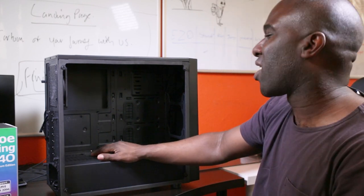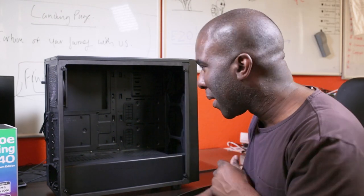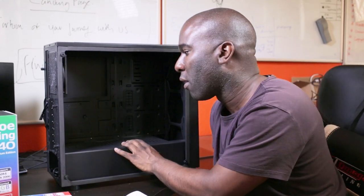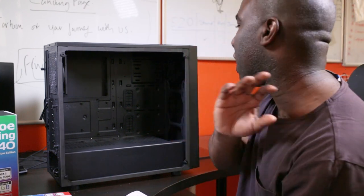Right, now we've got inside the case. Now, this case looks absolutely stunning. This case is bigger than the other Thermaltake that I did review. Links in the description down below about that one. But this one is pretty cool because it's got a nice little shroud on it, which most cases do have, obviously. 7 expansion slots on the back there. You can put ITX, micro ATX, and normal ATX, not extended ATX.